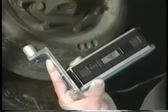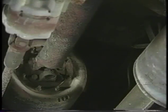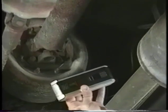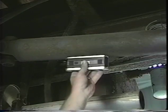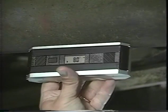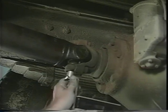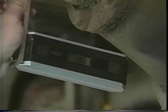In this application, remove the snap ring from the universal joint and take the reading directly off the bearing cap utilizing an adapter. This slope measures four degrees down. The next slope we must have is the centerline of the coupling shaft, measured directly off the tube — this slope measures seven degrees down. Now the drive shaft: this slope measures eight degrees down. Finally, we'll measure the slope of the axle, which is the actual centerline of the pinion shaft — this slope measures six degrees down.